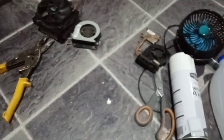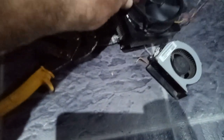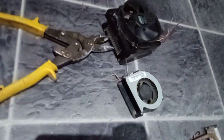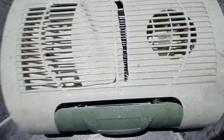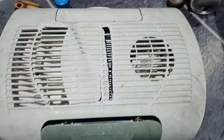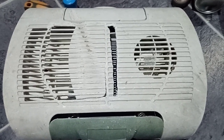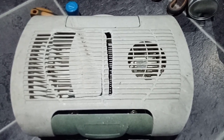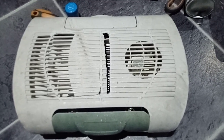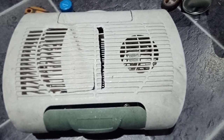For a basic mod to make it go colder, all you need is this old computer fan and a computer grill. These units draw about six amps of power — fine in your car while traveling since the alternator charges at 40–60 amps, but if you're parked up camping, three hours later your battery could be flat. If you live off-grid and just want extra cooling without running a full fridge, this mod helps get some extra cooling.